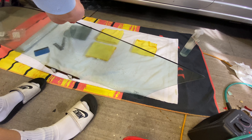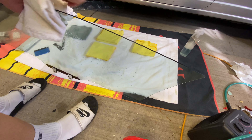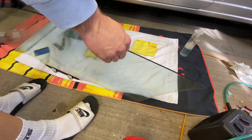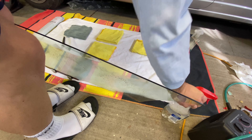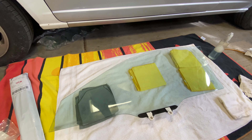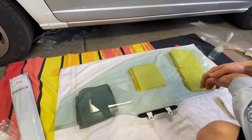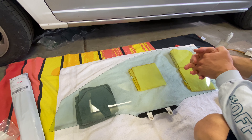Take a little extra time on the edges to get all that clean. Obviously most of you are going to be doing this on your car where the windows are actually still on your car — a little bit different situation here. So just get the edges clean as best you can. The concept is relatively simple: you're just going to be spraying soapy water across the window, laying the film on top of that, squeegeeing out the soapy water from behind the film, and then cutting the outline of the window. That's pretty much it, and we'll get to it.